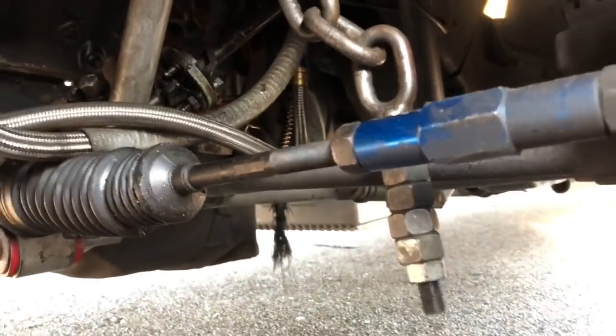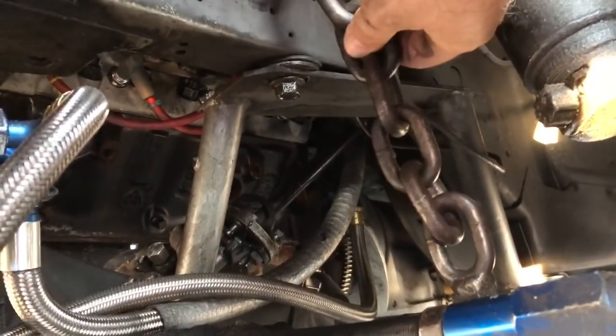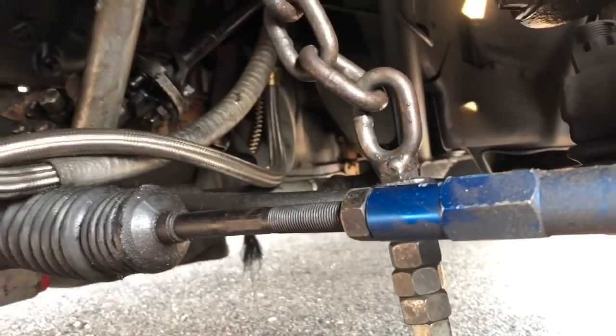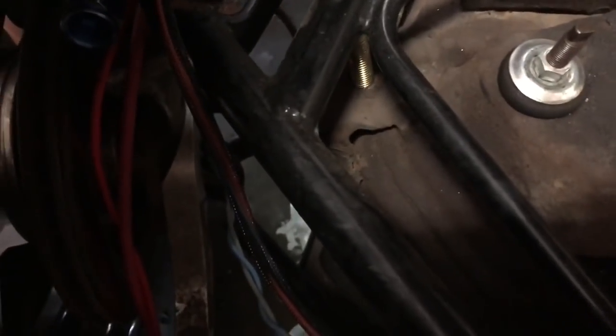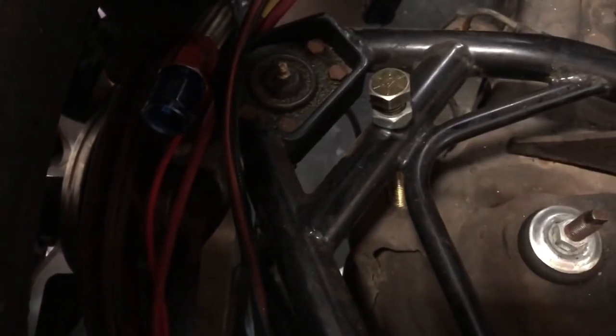Here's the length I just changed — I moved those nuts that were on top to the bottom. So now you can see it's on the control arm and it's got a lot less slack. This is about three-quarters of an inch when it translates out to the wheel. Also, a double-A arm on an older Nova — you can see it's got a jack screw in it. The screw goes down and hits the frame of the car, and how far it's screwed down determines how much front-end travel you can have.